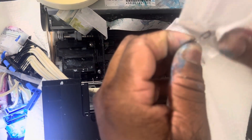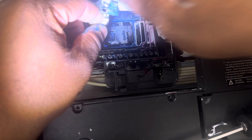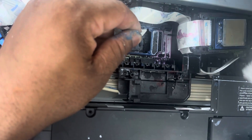Take your paper towel and clean that off, then set it to the side. Take the wire and lift the PE sensor out. Now you're going to wipe your PE sensor good with your napkin. Then you're going to pull it from the wire. Next, you have to take this wire and wipe it down.